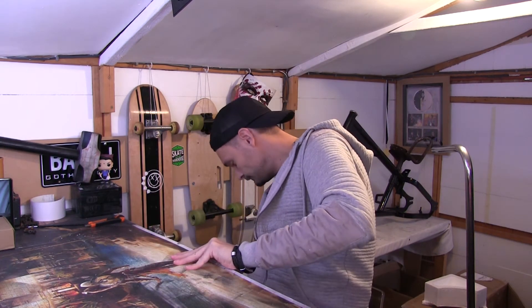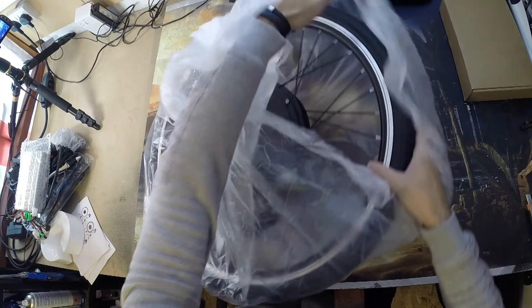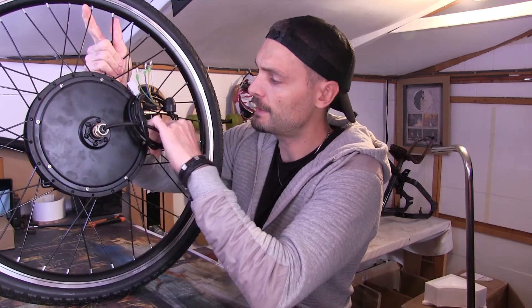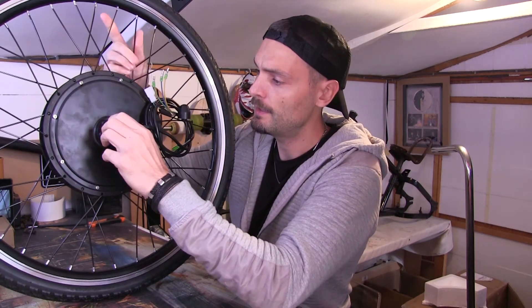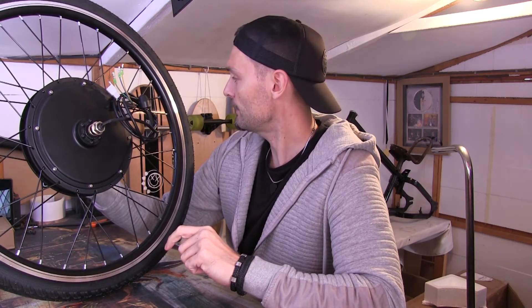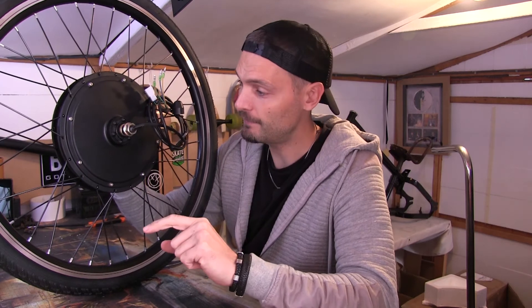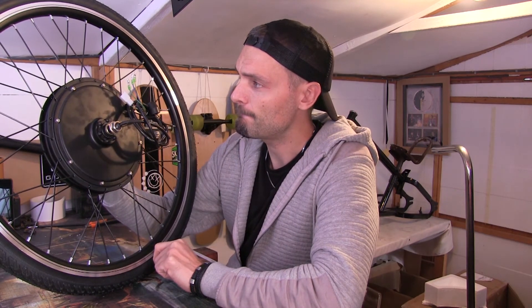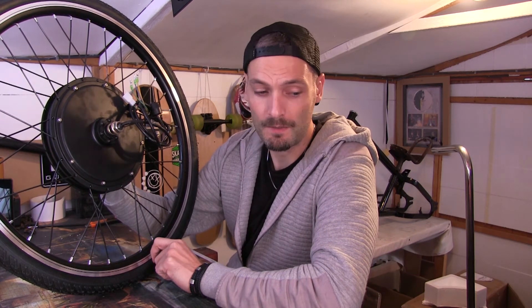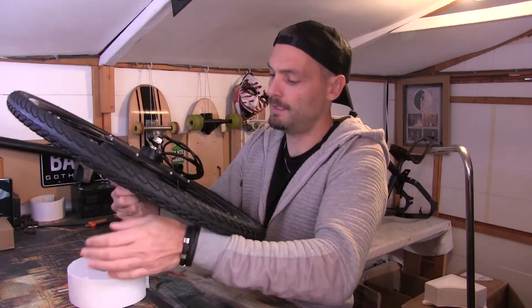You want to see the wheel, don't you? This weighs a lot. So this is the wheel and the wheel motor — this is basically your cable that's going to run into your controller. I've gone with a 26-inch wheel; the one currently on there is 24-inch, so there's a 2-inch difference, but I don't really see it being an issue. As for fitting the brake disc: the brake disc goes on this side of the wheel — you take off what's there, remove the plastic washer, and your disc goes on. And I'll need to put a bit of air in the tyre because it's quite flat.